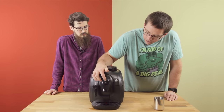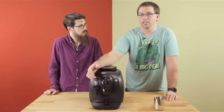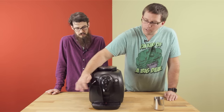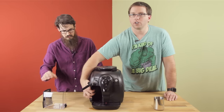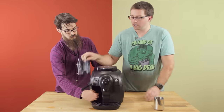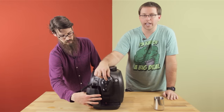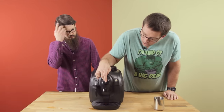The next option activates the pump, making sure it works. Another useful feature: sometimes these machines — new or refurbished — get a vapor lock in the pump. You can pull out the water tank, still run the pump, and use a plunger or syringe inserted where the tank goes in. Otherwise you'd have to stick both hands in there and trick the sensor, which is a nightmare, especially with big hands. This confirms the pump is working on this machine.